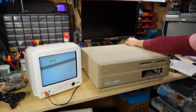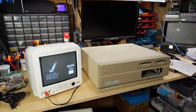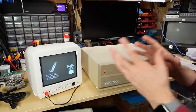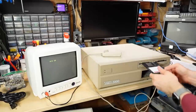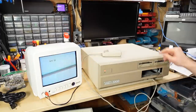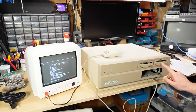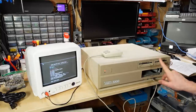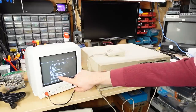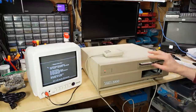It seems to be working. Let's see if it actually boots. Kickstart 2.0 — it's actually working. And I think the accelerator is in this computer, which is the one that had the battery damage. Let me boot up the Amiga test kit just to see if this thing is definitely working. The drive on the right wasn't able to boot the disc, but the one on the left had no problem. It does say 68030, meaning the accelerator card is working, with a total of nine megabytes. This floppy drive is not working.